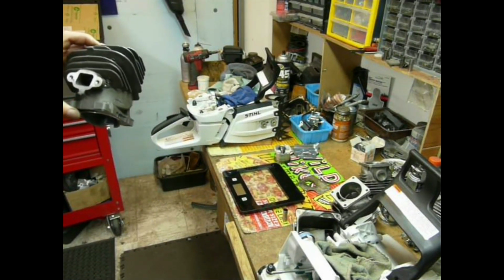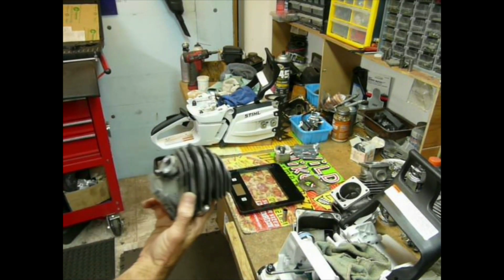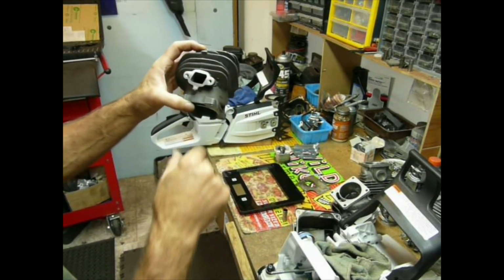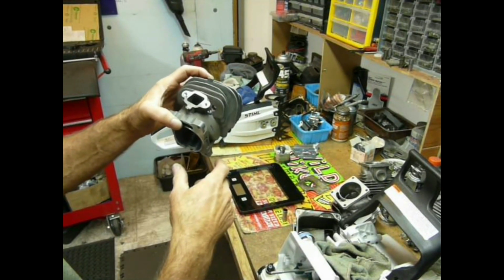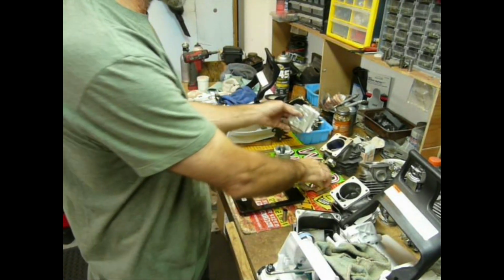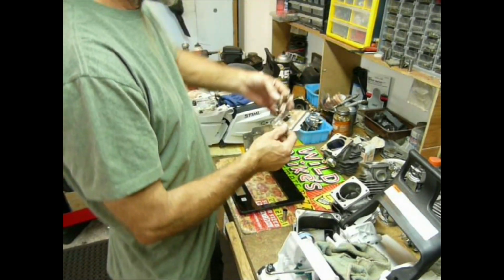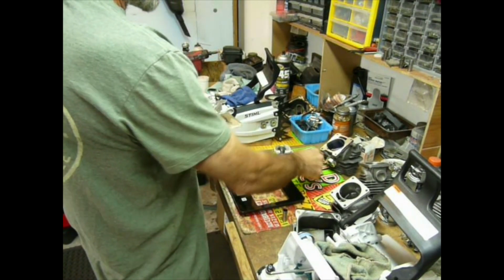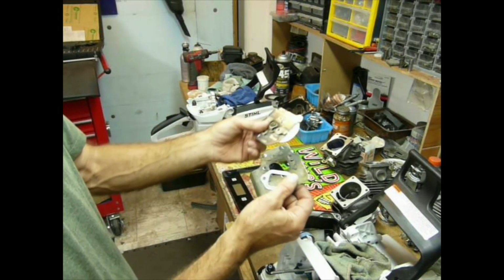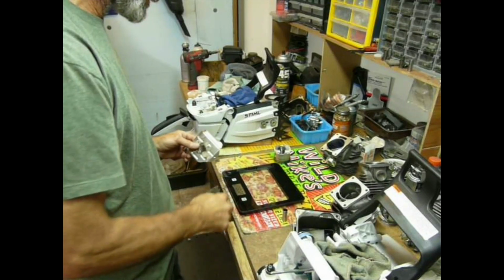Okay, so we've got to take a little bit of a look at the cylinder. 462 exhaust, the port's tilted a little bit, trying to get it to spin, I would imagine. And so yeah, we talked about some stuff. If we compare the gasket stuff, the cooling plate on the two saws, we see a lightweight aluminum plate and a fiber gasket versus a metal cooling plate and a metal gasket. We'll just take a real quick look at the weights.